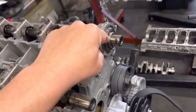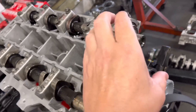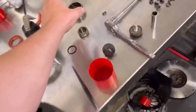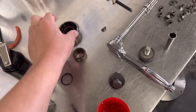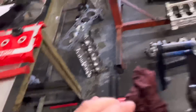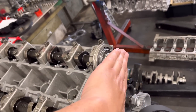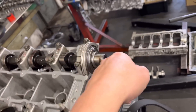Now the two-wheel drive and the four-wheel drive Cosworth front cam bearings - which is this bit here - that takes the load of the belt tension, stops the cam pulling down at the top. It's quite a good design. Here is the bearing in its stripped state - just a normal roller bearing with a seal on the outside. This bit goes on the inside which turns on the inside of the cam seal, and then this all does up with the front pulley on. When you torque up that front bolt for the cam pulley, it pushes it all together and stops the oil escaping and leaking out the bolt.